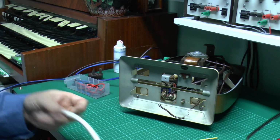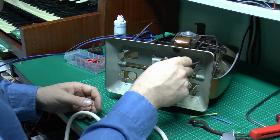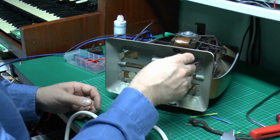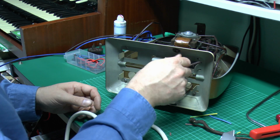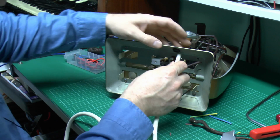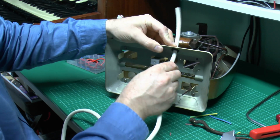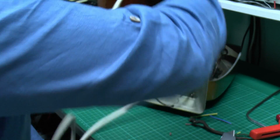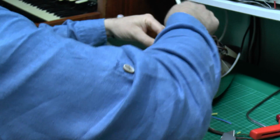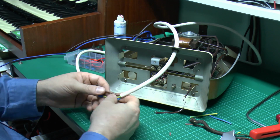2 metre mark. Now also this flex has to go via this clamping arrangement in here, so also it doesn't pull out and rip the wires from their terminals when someone trips over the lead. And we'll take one of these screws out completely, rather than trying to thread it underneath there, which is going to be a rather huge faff. So what we'll do is just thread that through the rubber grommet here. Just pull the flex through there. Now leave a fair bit loose there, so we can of course connect it to the terminals.